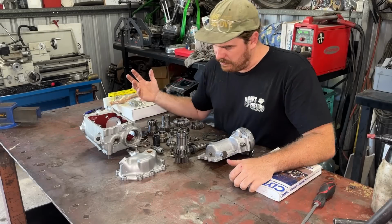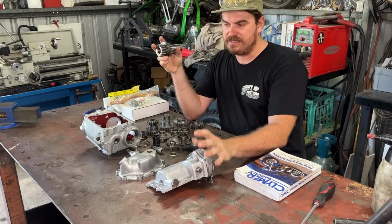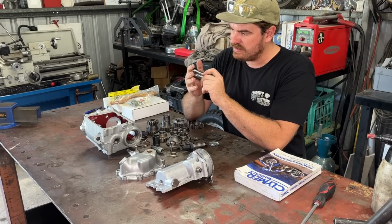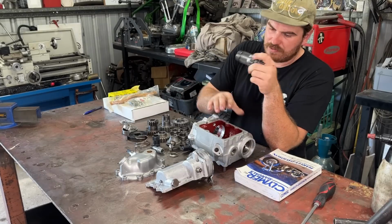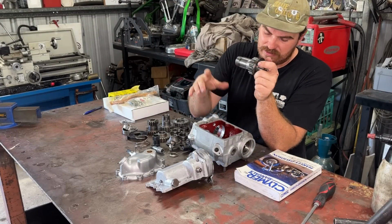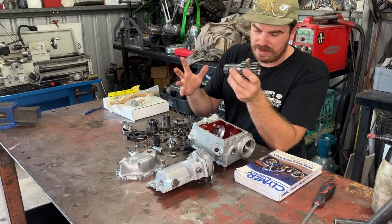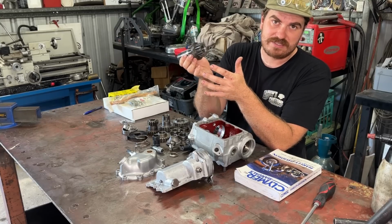Alright, so basically where I want to start is with our countershaft assembly. That is our first and second assembly. The reason I want to start there and knock this together first is we have to test fit this in the case. Remember, we want to set that float. We want to make sure this isn't tight in our case. We're aiming for 10 thou float, 5 thou float, whatever, just something so that this doesn't bang back and forth and it's not tight.